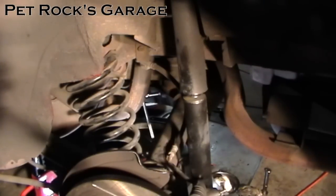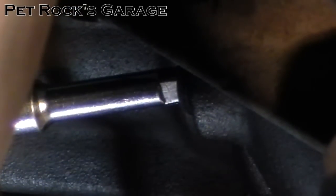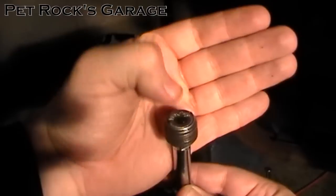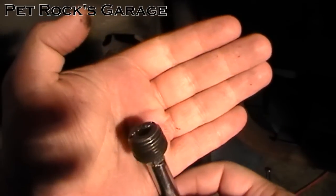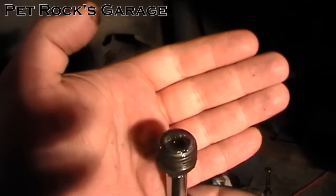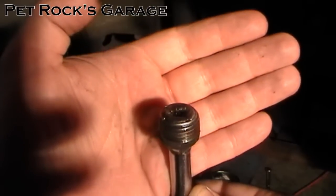Now I've waited 24 hours and the RTV has cured, so it's time to fill the differential. The fill hole on this differential is right there — if you look at it from the driver's side, I have a 3/8 extension in the fill plug to undo it; it's just a square 3/8 plug. I'd advise soaking it in some penetrating oil first before trying to break it loose because these things are known to rust. If you look closely at the plug there's a magnet on the end — this one has picked up a little bit of metal particles, but it doesn't look that bad. Since my gears were worn, I'm leaning towards this magnet not being sufficient to catch metal particles, which is why I added that larger magnet to the bottom before I bolted the cover on.